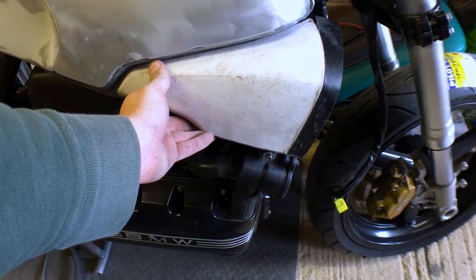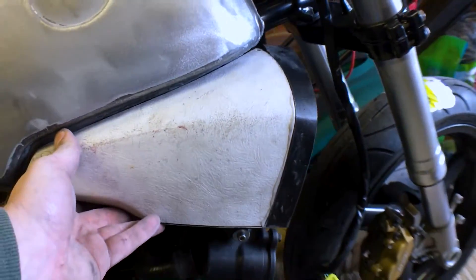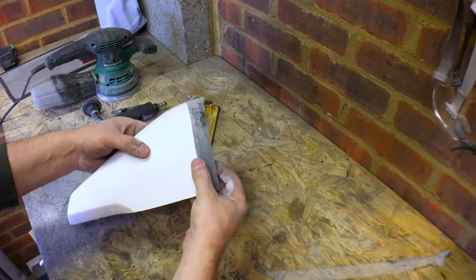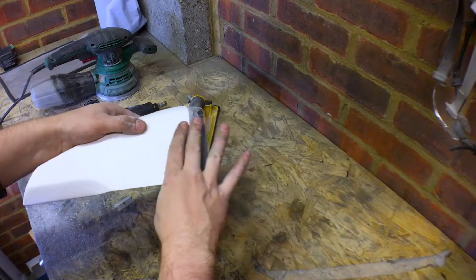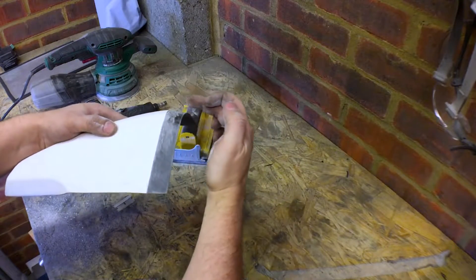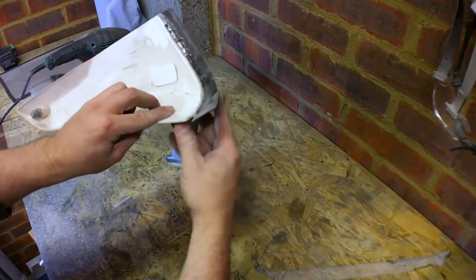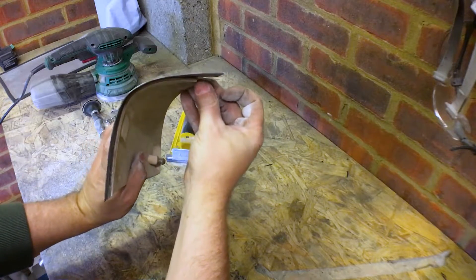So what I'm going to do now is go over it with the DA, get it all nice and smooth, put a little bit of filler around the edges, try and get those profiles a little bit tidier, and see how it goes. I've gone over this and as you can see it's a lot smoother now, looks a bit better. This is actually pretty much flush so I haven't really got to do much there, but there's a step in there — I want that to come straight out.